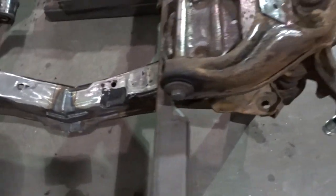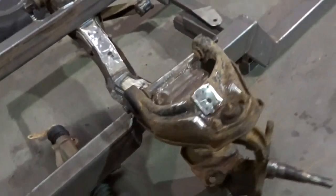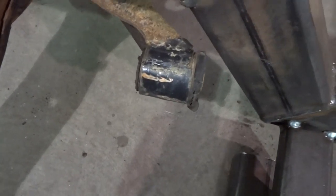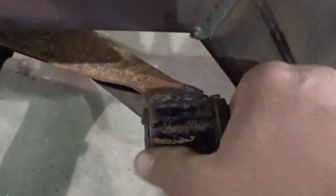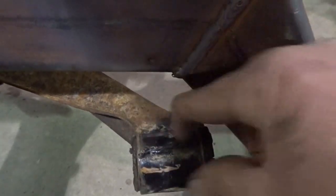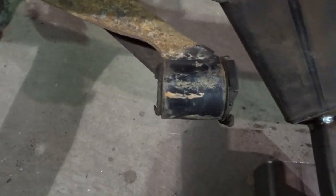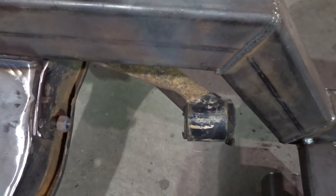You can see it's welded all in here and on the inside. You can see the notch there. The next thing I've got to build, other than the steering, is a mount at the back — on the factory Chevette chassis this mount is part of the body. I've got some tabs and used junk kicking around, and I just need to make some kind of reinforcement to hold the bottom of the control arm to the frame.